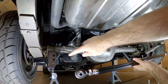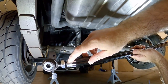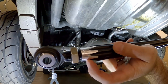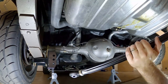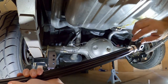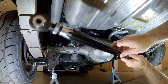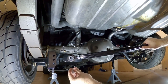Before putting the bar into the spring plate, I want to point out something cool. On the machined end of the adjustable bar, if you flip it around you'll see a little stripe in there — that's to let you know this is the left-hand thread end, while the other end is normal right-hand thread. It's a nice detail so you don't force it in. It doesn't matter which orientation it goes in — I'm just going to put it in this way for now and put the bolt through the eyelet just to hold it in place.